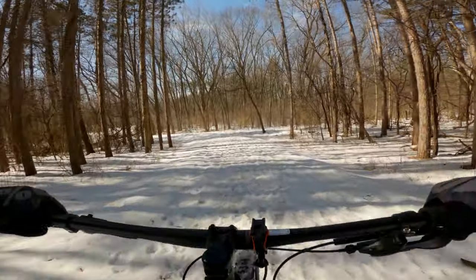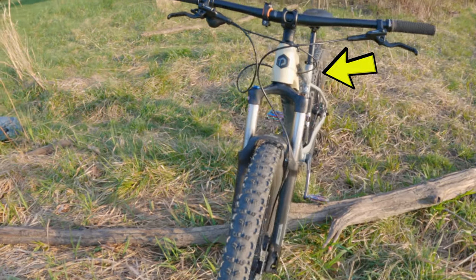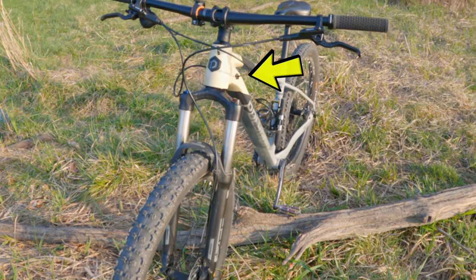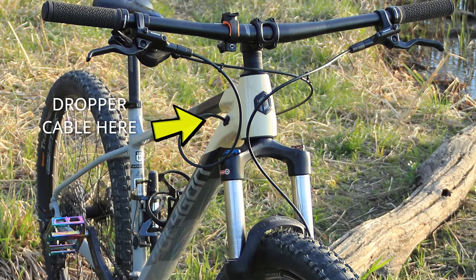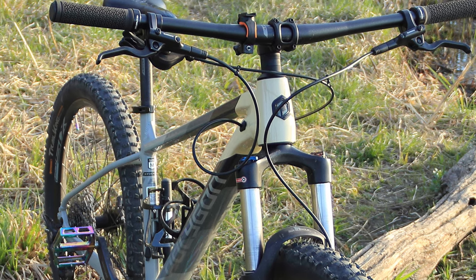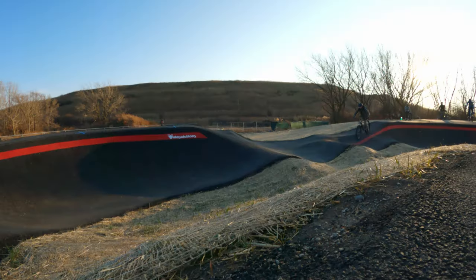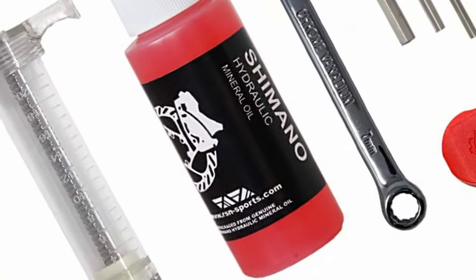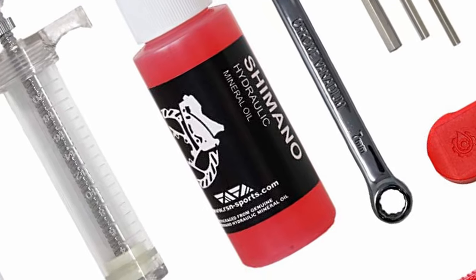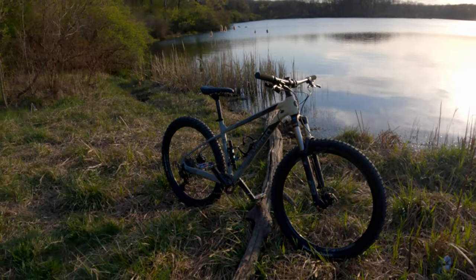I had a few gripes with the bike that are worth mentioning — mainly setup items. The first is the internal cable routing. The shift cable and brakes should both be routed through the left-side cable port; it makes more sense to leave the right side unused for those that decide to install a dropper post. This bike came with the brake hose routed through the right-side port, which adds an extra step of having to reroute the rear brake to the left side. This will most likely require a brake bleed, which is an unnecessary step and adds cost.